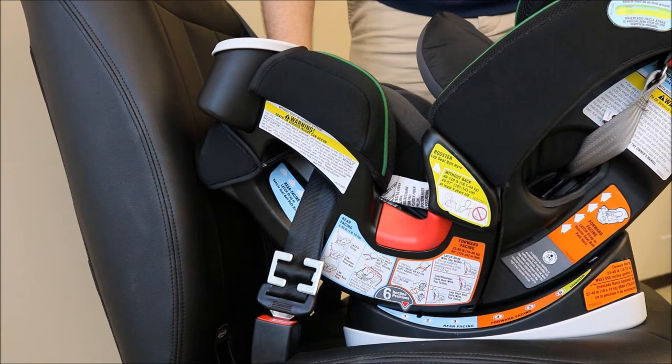If you are not able to buckle your seat belt, your locking clip has made the seat belt too short. Please reapply the locking clip so that your seat belt is slightly longer and try to buckle your seat belt again. Your locking clip should still be less than one inch away from the sliding latch plate and all four prongs should be on top of the seat belt.